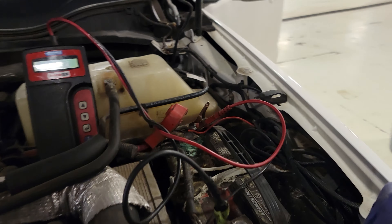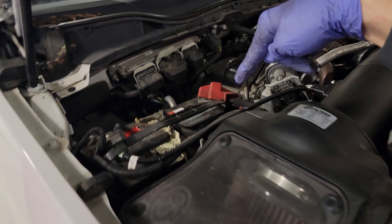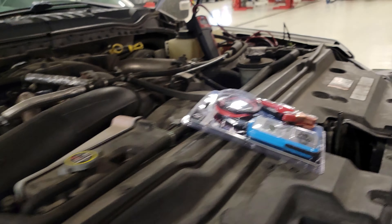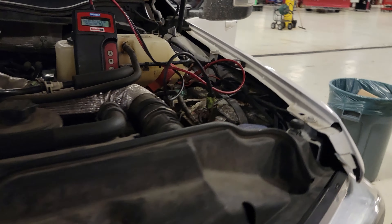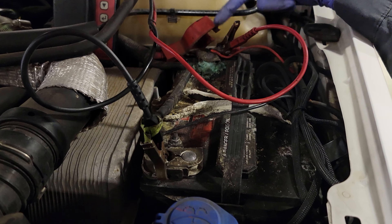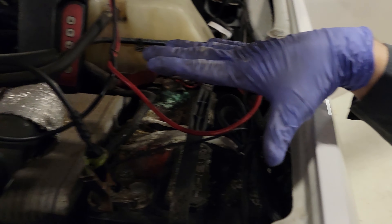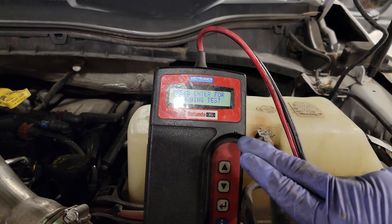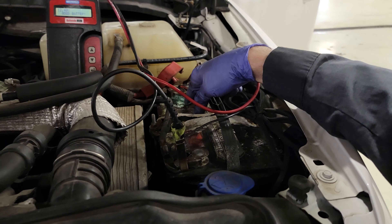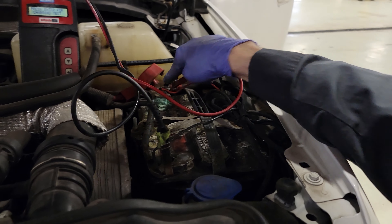One thing I just skipped over — see if you guys notice — these batteries are all hooked together, that positive is going over to that positive. In theory I just checked both batteries together. If you're checking your batteries on your Super Duty with dual batteries, go ahead and disconnect either the negative or the positive. You do not want these batteries connected together — check each battery by itself for accurate readings. Definitely disconnect one battery lead prior to testing.